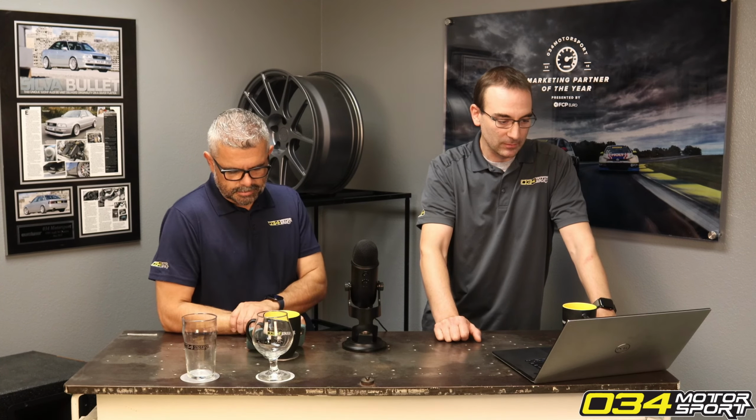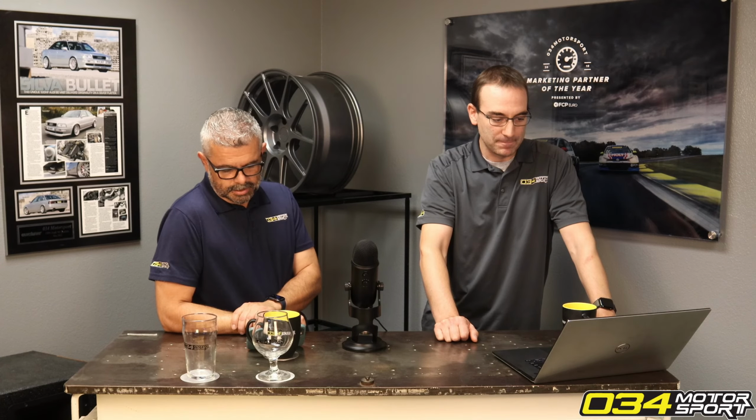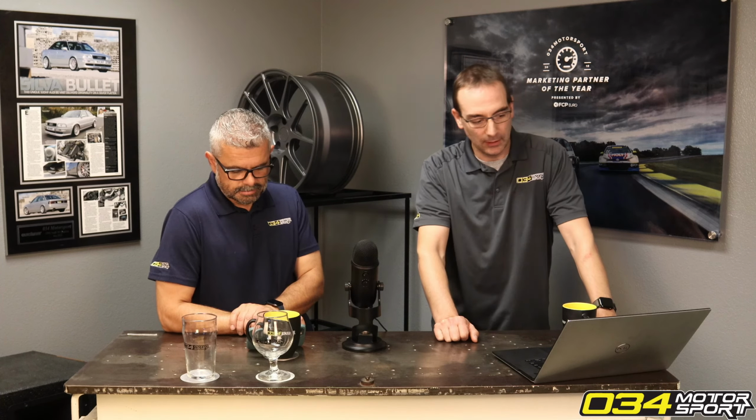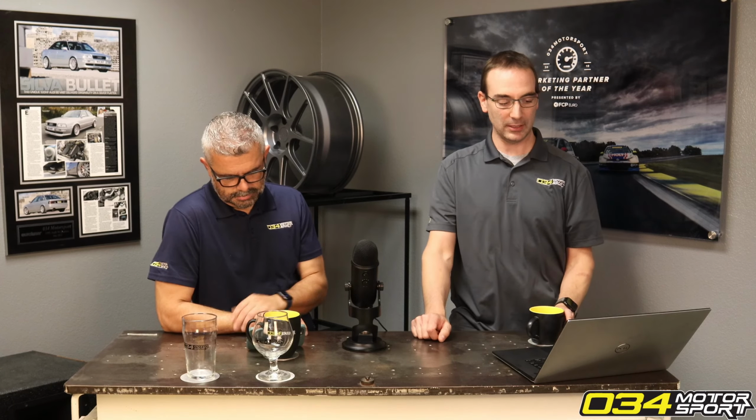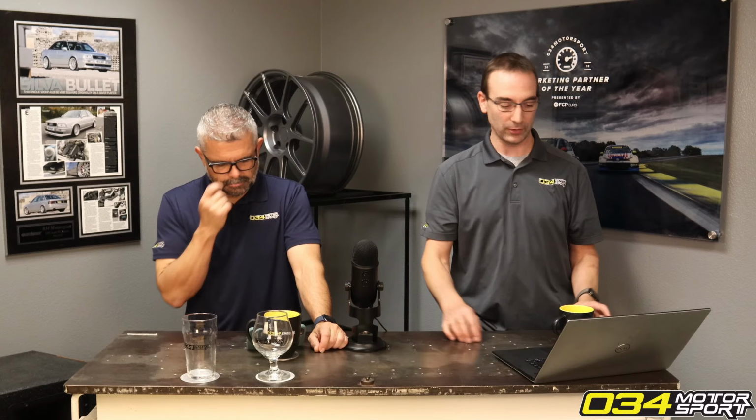For customers in countries without readily available E85, UK, Europe, do you have methanol injection supported software for stage 2 for the 3.0T B8 and B9? Yeah, we've talked about this before. It's a tough one to really support and rely on. We do have some methanol injection files up, but we try not to recommend that route very often because the methanol system is completely outside of the ECU's control. We have no way to monitor or meter or proactively handle any of the methanol injection. That's all done basically, am I into crazy fuel trims and are my air temps really wonky now? Then that's probably working. And that's kind of all we have to tune from on the ECU side.